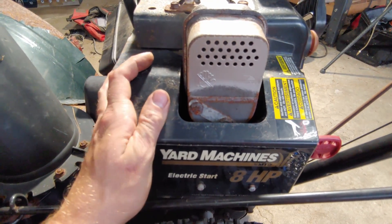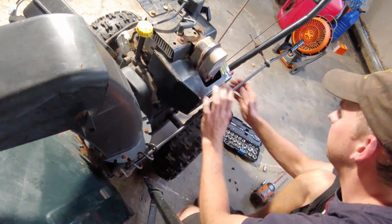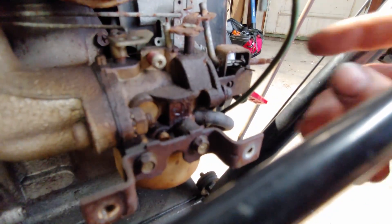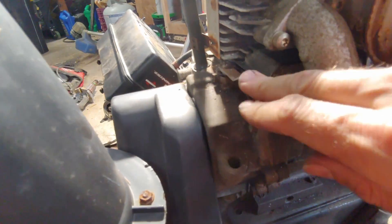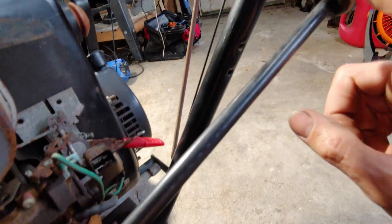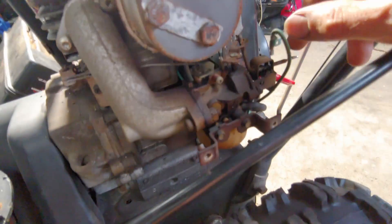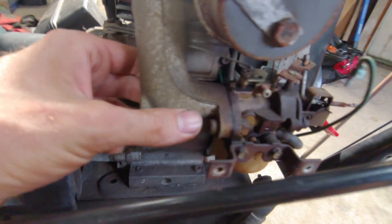All this stuff is rusted to heck, so I'm going to strip something eventually. Now that I got the cover off, just playing around with the throttle and the governor and all that, I can see everything is a little seized up. It's moving super pokey over here - this should be an instant snap. So I know I have to lubricate all these moving parts around here, which is super easy. This carburetor is very easy to get off compared to my other snowblower. This one looks like all I have to do is take out these two bolts right here and then disconnect the fuel line and that little line will be good to go.